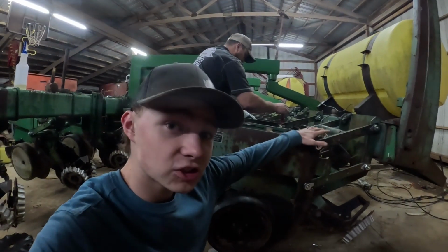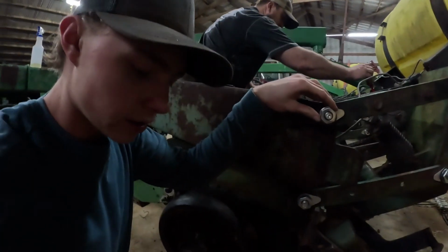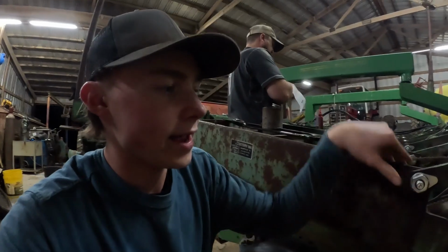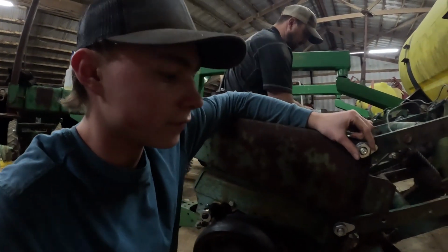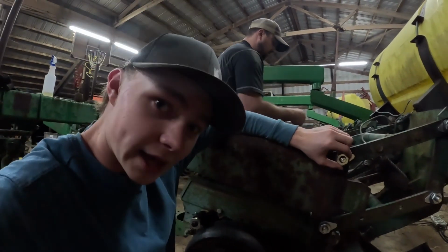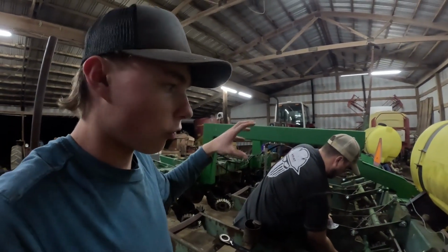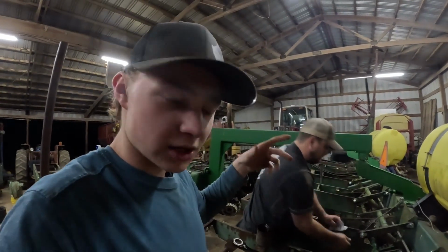We are on the last stretch for our parallel arms. So all of these nuts and bushings that we have on here, you see this really thin nut right here? It's actually got a bushing piece that slides in there too to meet with the bolt. This nut has to be torqued to 145 foot-pounds, and then we have to put a jam nut on the end with some Loctite, and that has to be torqued to 100 foot-pounds. So you look at 13 rows here, 4 bolts per row, and then you have to go through and put another 4 jam nuts on there.